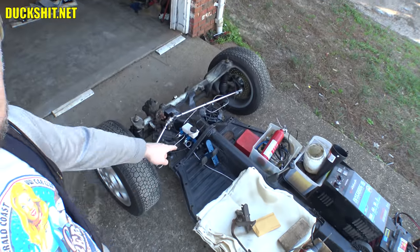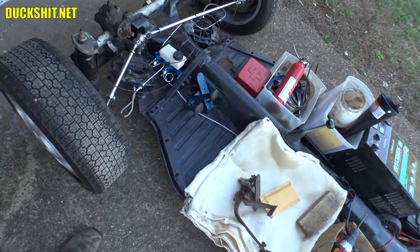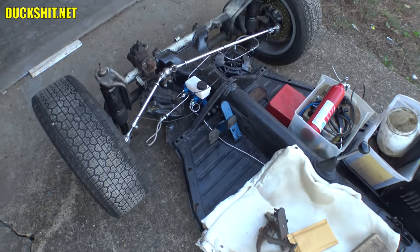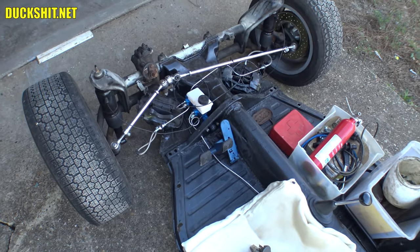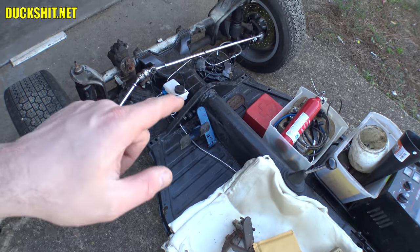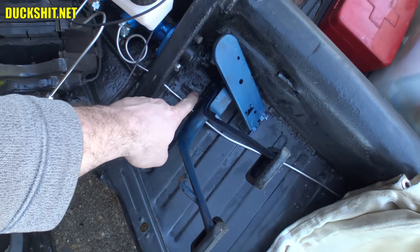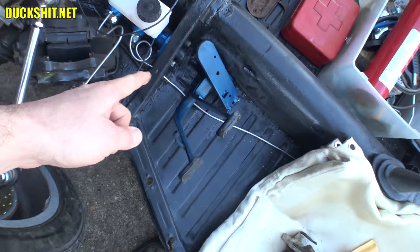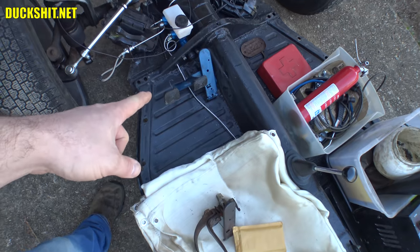Let's talk about the pedal cluster you see down here on my Beetle chassis. This belongs to Eleanor, my 1956 Beetle. As you probably remember, I've put a lot of care and attention into creating this pan and upgrading a bunch of different things on it. There's a pedal cluster and a clutch, and as you notice, when I let go of it, it returns to a position and stops. People have asked why it does that. You can see the bolt and the slot that the bolt goes through — that is the pedal stop, and it's actually adjustable. You can push it forwards and back.